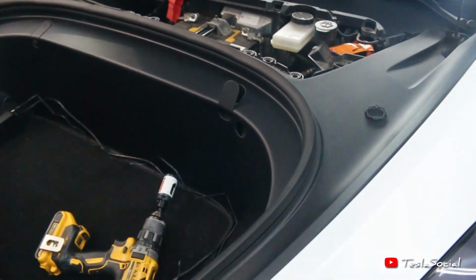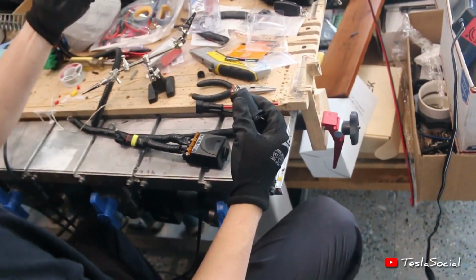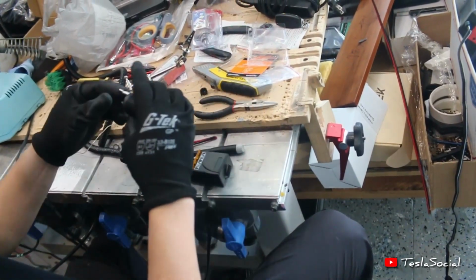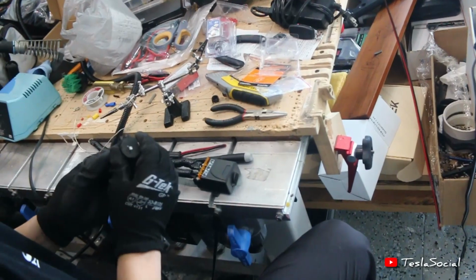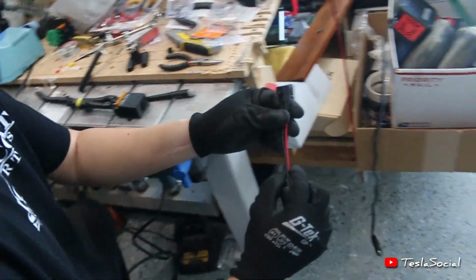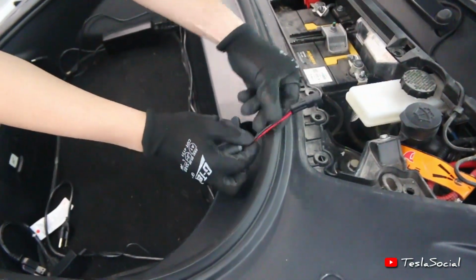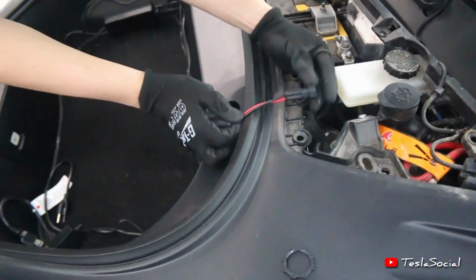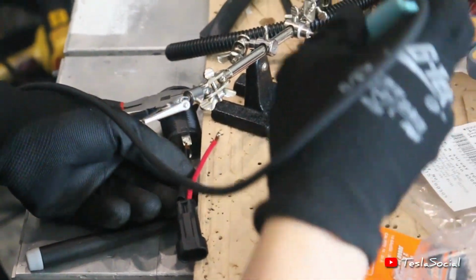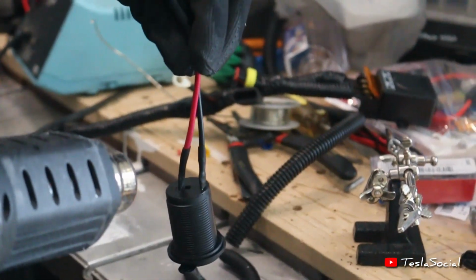All right. Got that. What do you think, Wade? Should I just solder this thing on here, or use the spade, which I don't like? With vibration, spades could potentially vibrate loose. Case in point. Okay. I'm just going to solder it on there. How about that? And then you'll have a disconnect on the other side somewhere. Yeah, right here. This is going to go here? Yep, that's where we need. Wait, let me see, is it long enough? You'd reach in and just unplug it, right?